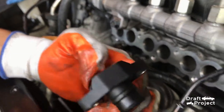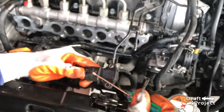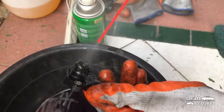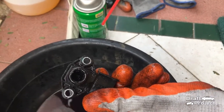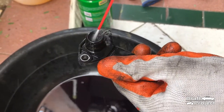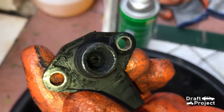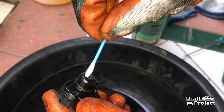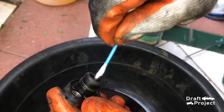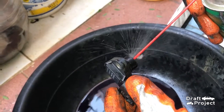The MAP sensor is filled with carbon deposits. I am going to separate it from the electrical socket, then clean it with an electrical cleaner. Some of the dirt was removed, so I am going to repeat the process. But this time I will use Q-tips to clean the inner part. Remember, clean it by pulling the dirt out — not by pushing it inside.